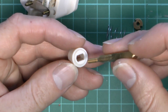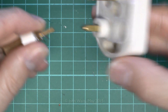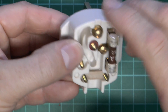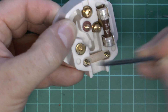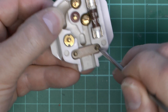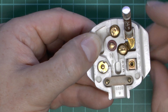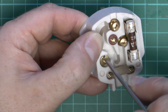I'm going to reassemble this so it doesn't get totally destroyed. The pin just slides in, spring on the back, and it goes through the hole in the back in the right alignment and locks in place so it won't rotate. The small brass piece on the back is secured to stop the pin falling out. The other side has the fuse holder so the fixing is under there — I think it's actually riveted in, so we won't be able to take that one out, but it'll be a very similar arrangement with the extended pin. So until next time, thanks for watching.